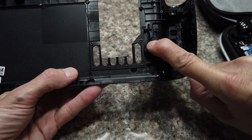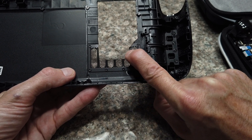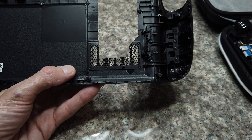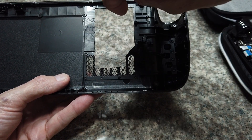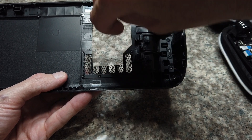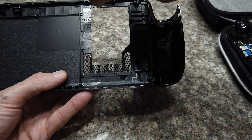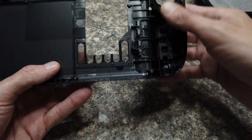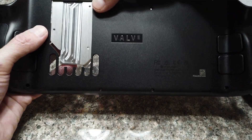This fan grill here is actually metal, so I recommend cutting this part at least with a Dremel so you get a nice clean cut. You can cut the plastic however you like — it's usually easiest to drill holes in the corners and then use a hacksaw blade to make a rough cut. Then you file it to the final size, testing the plate in the hole as you go so you don't remove too much material.